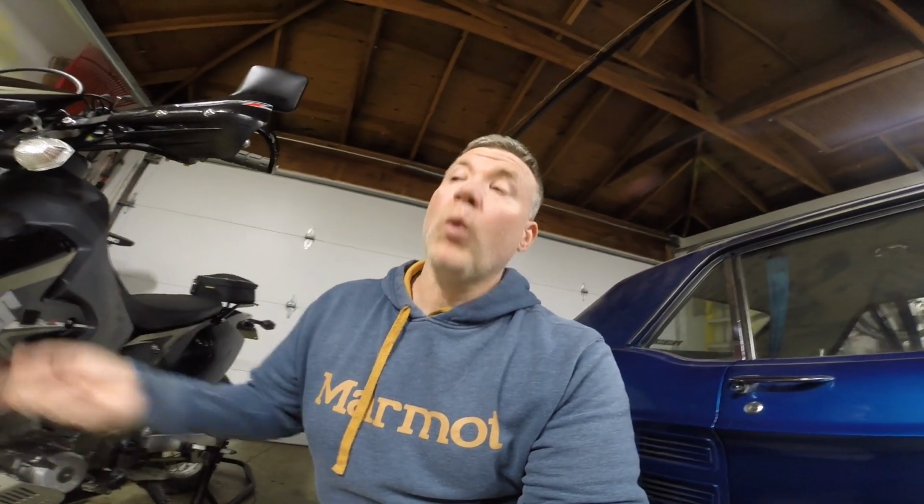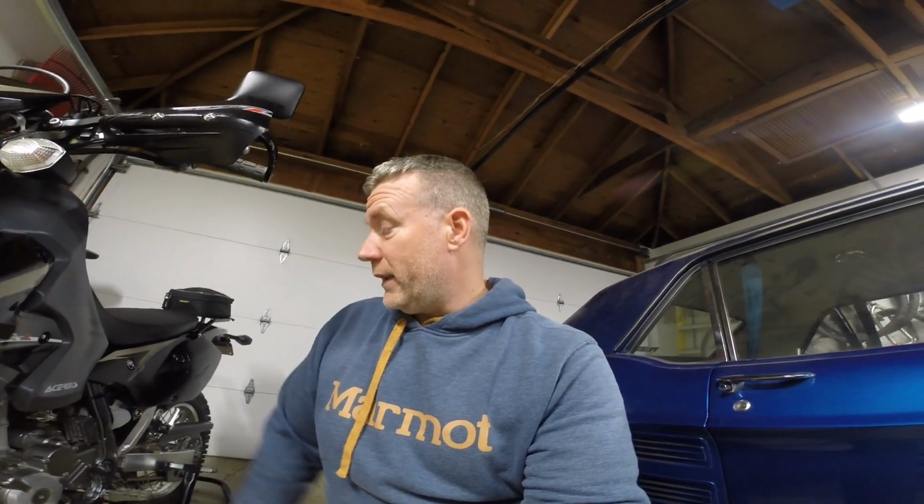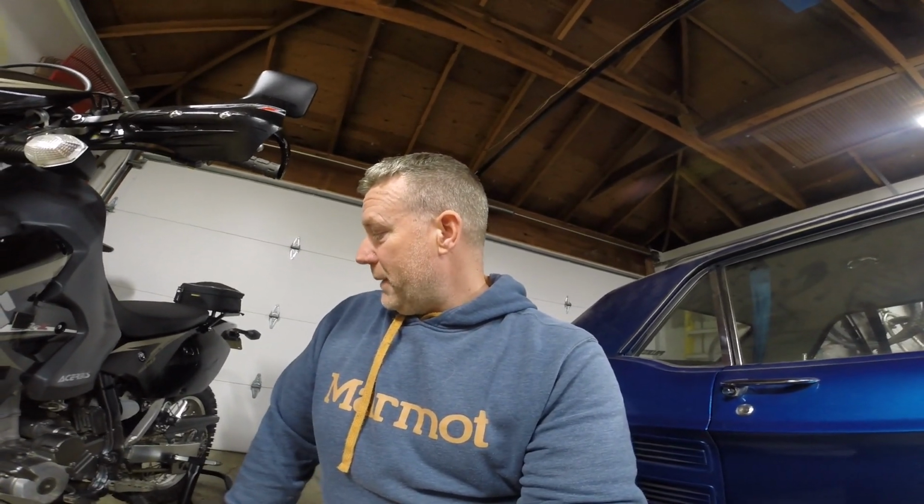You heat the oil, you heat the engine up, which makes the oil flow out a lot better. So you're getting more contaminants from inside the engine out when the oil is warm and it flows. You get more of the oil out compared to being stone cold when you do it. So that's the reason why you heat the oil up. Anyway, once it's warmed up, I'll get back to you and we'll start going into detail about how this works.